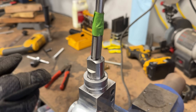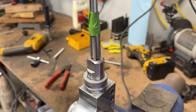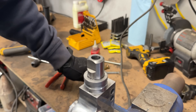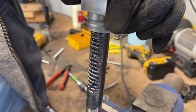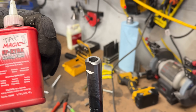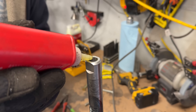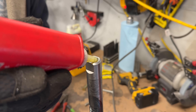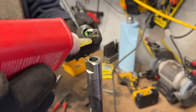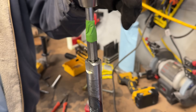So it looks like this is the right size. I know you see the rack itself moving — I probably should have locked it instead of using the body of it. There is a flat spot on the other side, so I'm going to use that for tapping. You are going to want some kind of lubricant — I use Tap Magic. I love this stuff; it makes cutting, tapping, and anything that needs lubrication so much nicer to do.